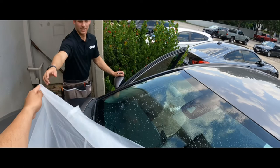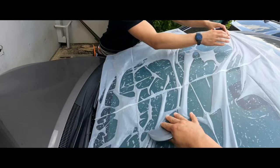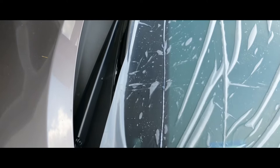It's a nice sunny day, so I'm going to put the clear trash bag on the outside of the front windshield — this is the window I'm going to remove the film from. I'm going to draw my perimeter and anchor the middle so the film doesn't move, then draw the border so I'm not cutting on the customer's vehicle.